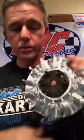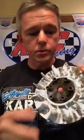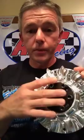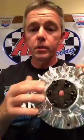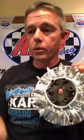So this one's made for the flathead. And I honestly forgot one of the most important flywheels I wanted to bring. We've got what's called a drag racing version. It's a 6615. All these are online. Take these numbers, look them up. You can see them, but it's a finless design, the 6615, just like the 17 without the fins, works on the flathead. We got a hub for the Honda clone, the non-Hemi Predator, the GX390,